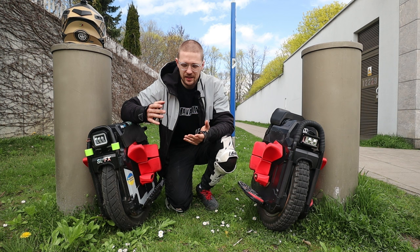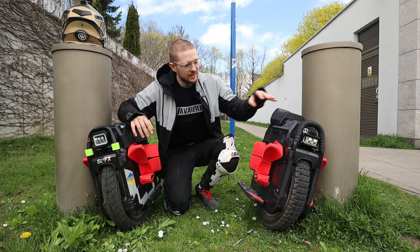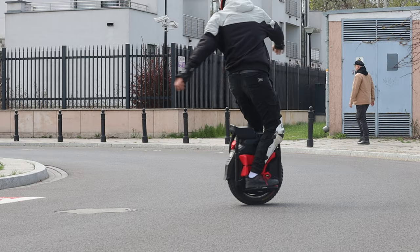Now the tread can vary, from off-road tires to street tires, and this is like the biggest extreme. In between those two, this tire will feel a little less wobbly. It will have sort of more stability at high speed, but it won't allow you to make sharp turns and be very agile at lower speeds.